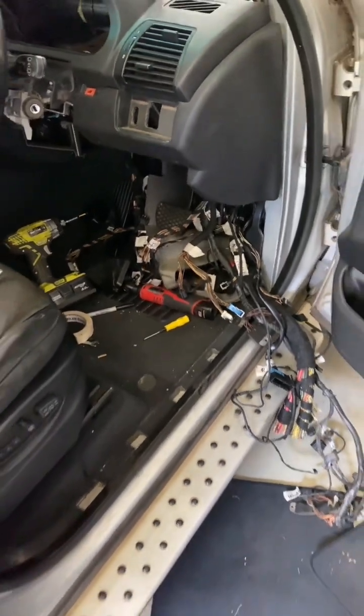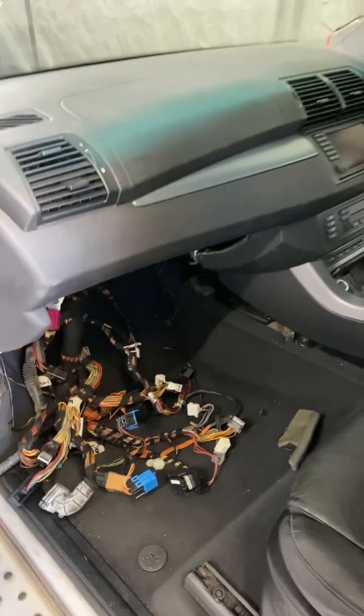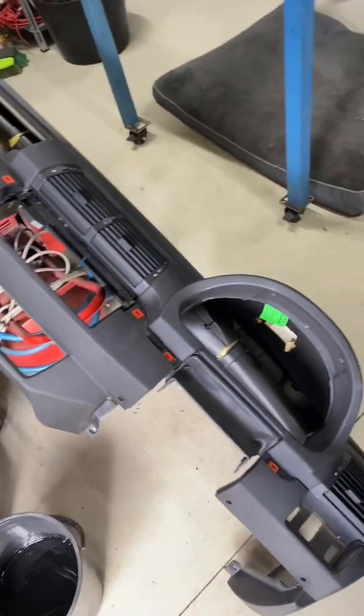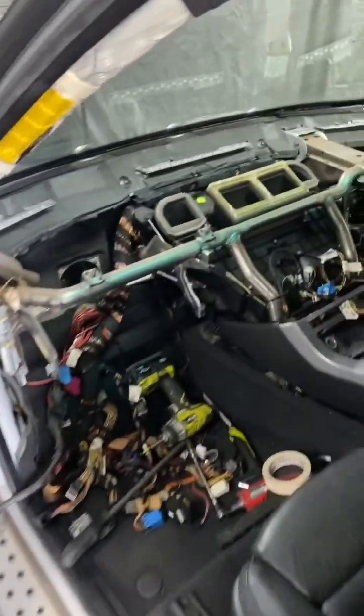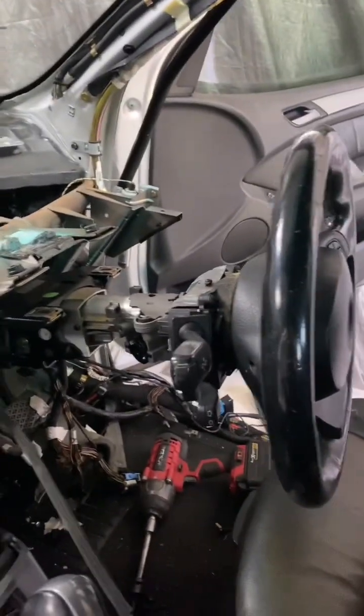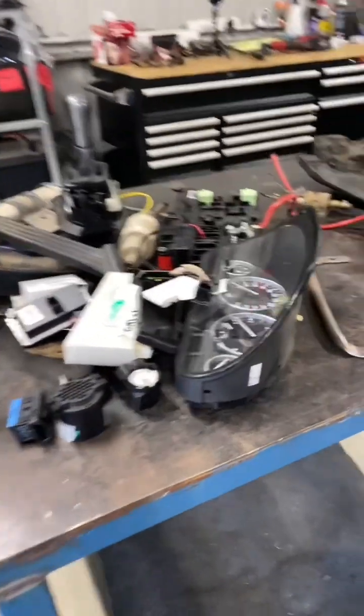The screw pulled out on the driver's side and also here on the passenger side. So we're just going to get the center section out and it's completely removed. Anyone need a dash? A couple more screws and it was out, so it was much easier. You can see trying to get to this loom was a nightmare from underneath, so I just popped those few screws out, let the steering column down, and pulled this loom out. The loom is completely out and we've got a few other little bits and bobs on the bench.